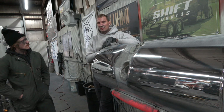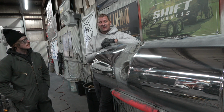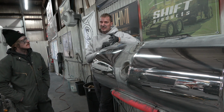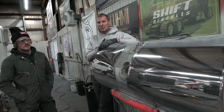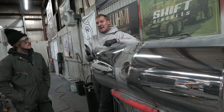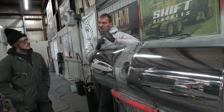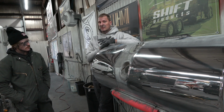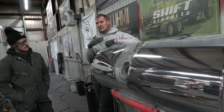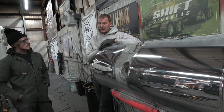So if you're sanding with 320 and the pits that you want out aren't out, drop down to 220. If 220 doesn't get it smooth, drop it down to 180. Just keep stepping down until you find the grit that gets it as smooth as you want, and then work every step back up until 600 or 400, and then you're polishable. And everything else from there is just polishing. So you're sanding, start where it gets everything out, work it back up to 600, cut and color everything, and you're good as gold. But I want to thank Nick for coming in on this one.